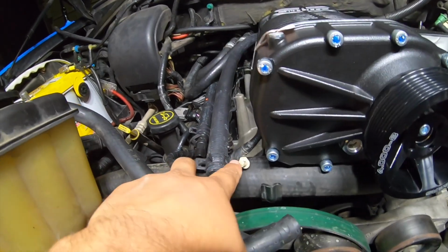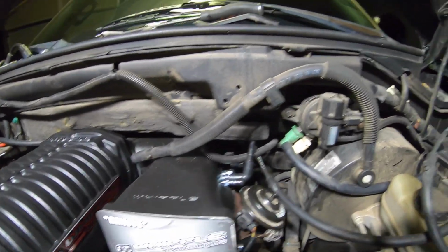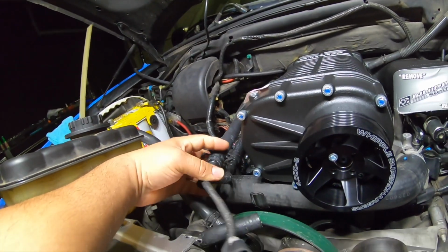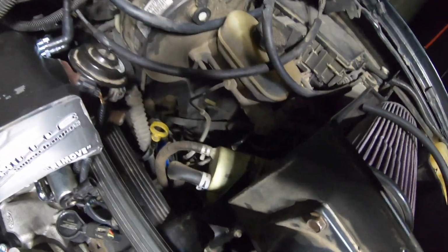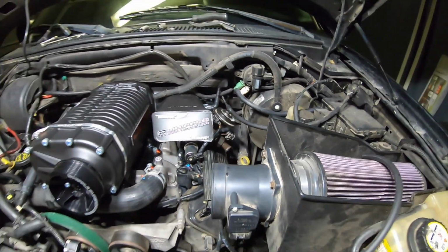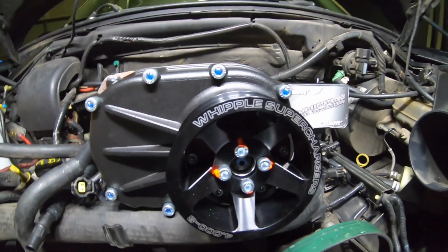Those hoses, I have to install those right now. Remove that ugly EGR, and then put the new plate in there. Connect all those hoses. The booster, I have to cut these wires and then extend them. And finally, I might be working on the power steering reservoir relocation. I'm gonna go ahead and do all that, and I'll get back with you guys. See you soon. Yeah, so I have the pulley installed, torqued to 110 inch-pounds.